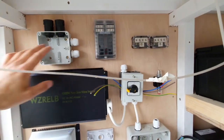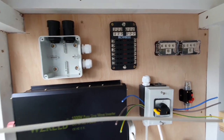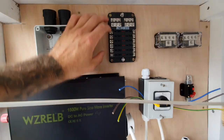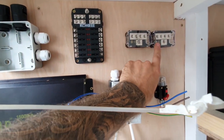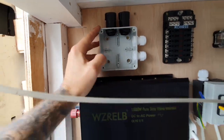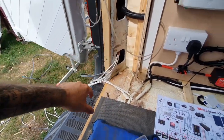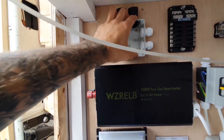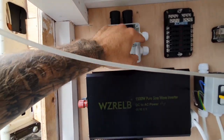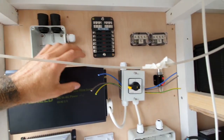Then we move up top to the 12 volt setup. This is my 12 volt fuse box — my distribution board — which will do all my lights, fridge, water pump, and all that. There's a negative and a positive, which will connect onto the negative and positive blocks. And then this here is my lighting junction box. All my cables come down to the back of here to a common point, and my switch wires come through from that cupboard. They'll wire into this junction box and I'll take the supplies off the fuse box through there.